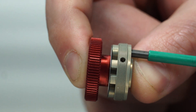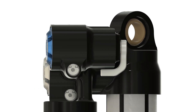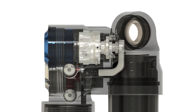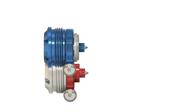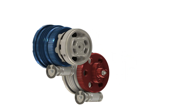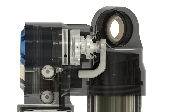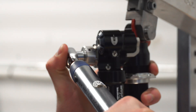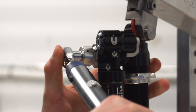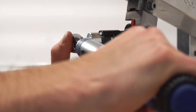This is exactly the same effect as exchanging the shims for thicker or thinner shims, but doesn't require the shock to be pulled apart to do it. To physically achieve this, first the clamping force needs to be released so that we can move things. This is done by loosening the damping end cap a quarter of a turn. From here, the worm drive is used to set the rotational position of the variable clamp to the specification given by the Tuning Hub. Then we clamp the mechanism back together by re-torquing the damping end cap. The worm gear ensures that the variable clamp remains in position when the end cap is being torqued. That's it — that's the whole thing. That's how easy and elegant the whole Rapid Revalve process is, and why we can legitimately claim to have laid waste to conventional revalving processes.